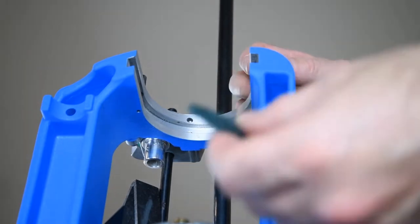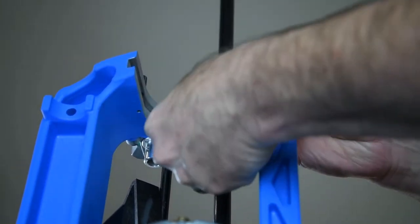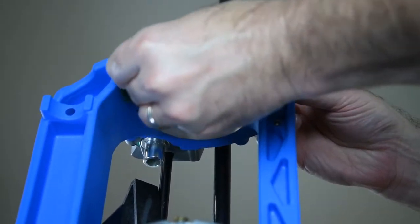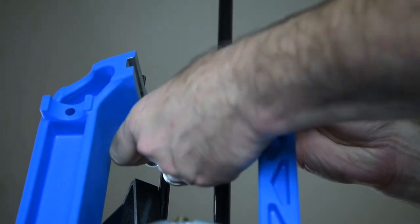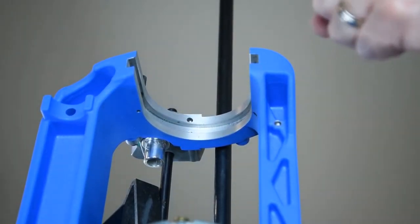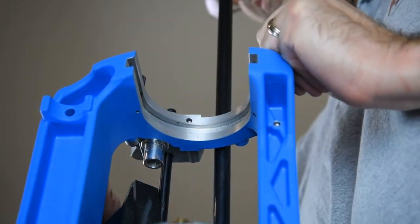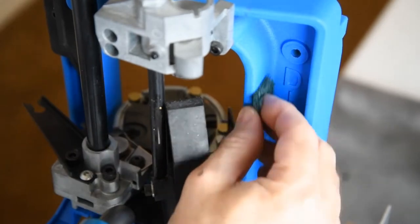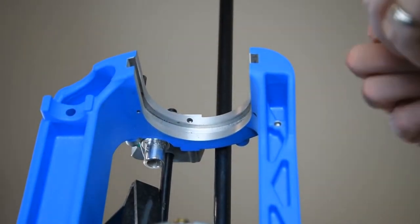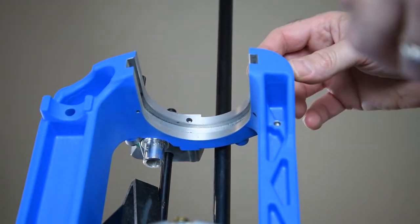Okay, the next step is we'll want to take our abrasive pad and we'll scuff up these areas. And this will make sure that it breaks that gloss coat and will also aid in the bond. And then, of course, the area there in the back for that wire mount is going to go.